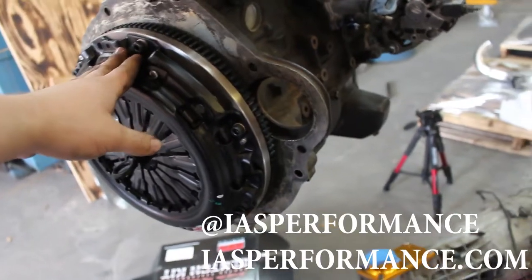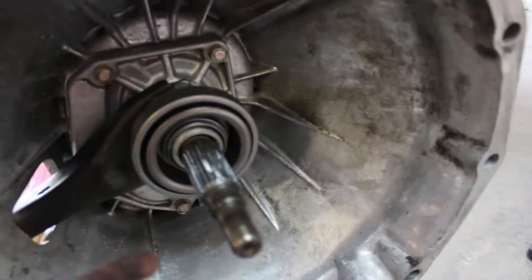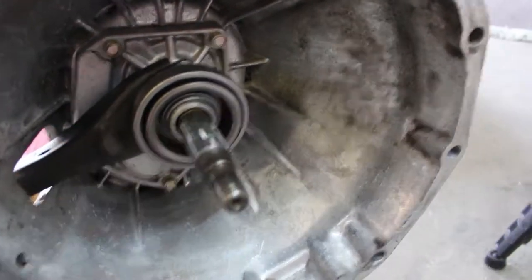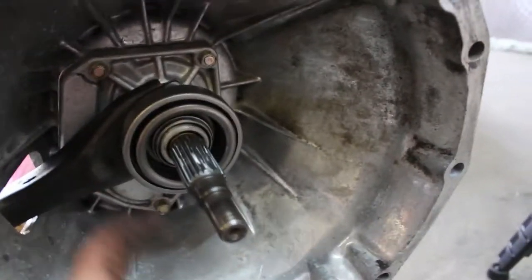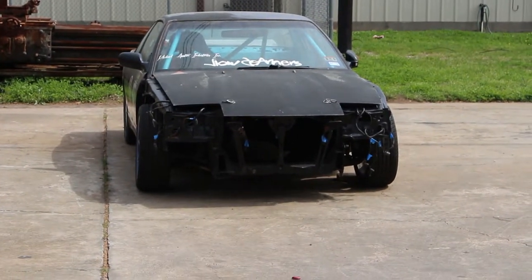Great pricing, so they got that for me. Here's the transmission — I got it all cleaned up. With that kit it comes with the new pilot bushing, which I already put in there, and the throw out bearing. I got that cleaned up and greased a little bit, not too much. So we're going to go ahead and stab the transmission on there, and then we are going to be putting the motor in the car.